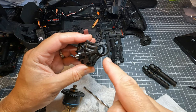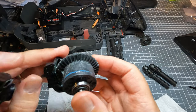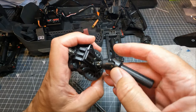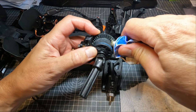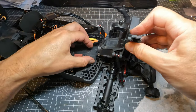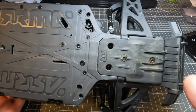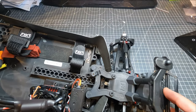When putting the diff back together, make sure it's the right way up — that's the down side, that's the upside, and the bevel gear goes on that side. It did have plenty of grease in but I'll put a little bit more while I'm here. Then put the drive shafts back together. The front diff is the same operation — there are the same screws plus one extra. I'll just do that off camera.